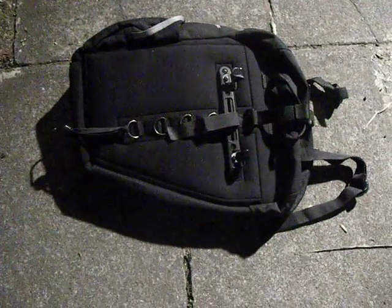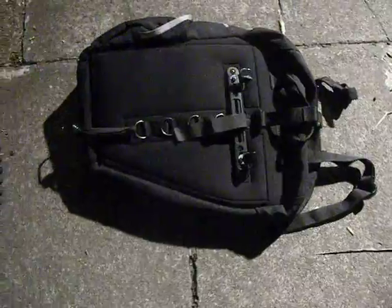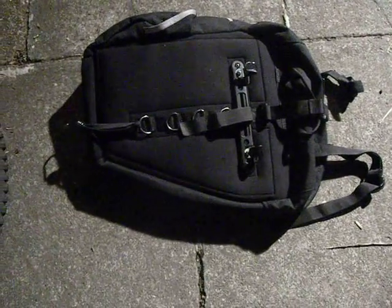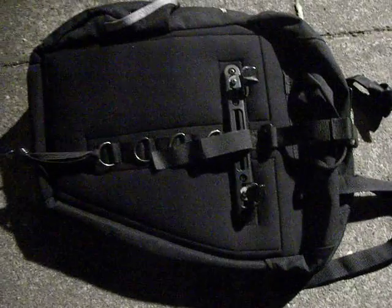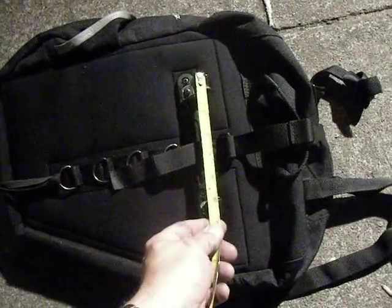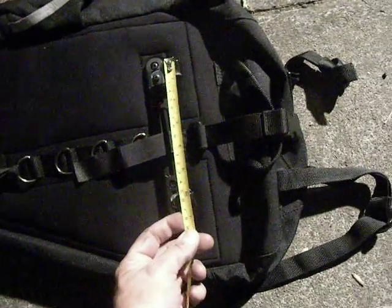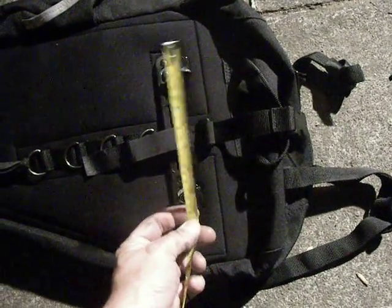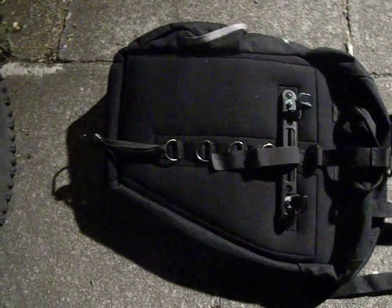Now this little demon tweak might work for front as well as back panniers. Panniers keep dropping off the racks. If you measure the critical dimension, which is this, you discover that it's about 17 centimetres. Go down to your local car spare shop and purchase a couple of Jubilee clips.